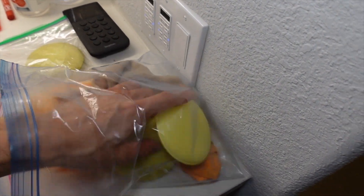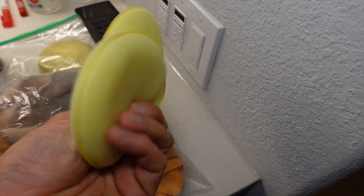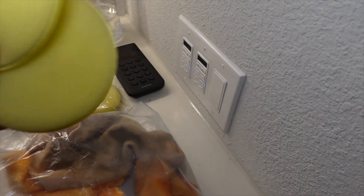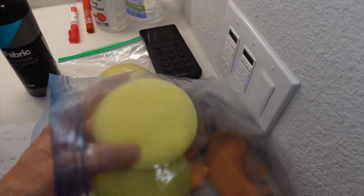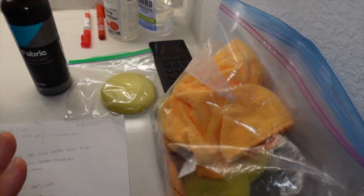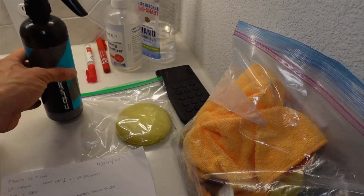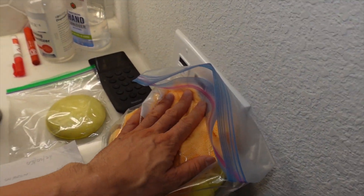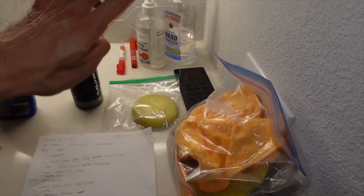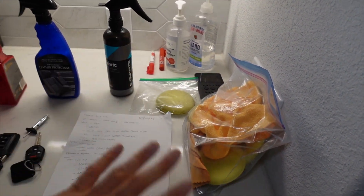It's really dirty so I don't want to use that. I started using foam applicators, and these are by far the best for applying any detailing product in my opinion, except for maybe cleaning windows. Everything seems to go on nice and evenly, and honestly you don't have to use as much product because it's not being soaked up by the towel. You just spray on the foam applicator or in the area and then use the applicator to put it on.